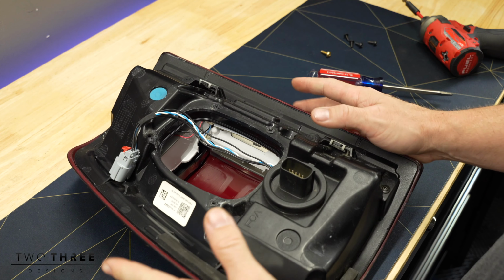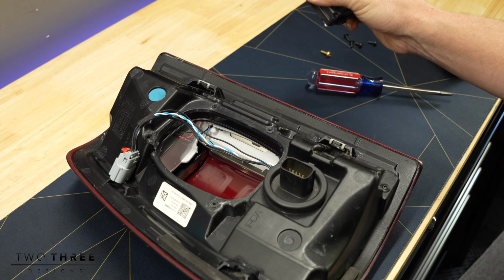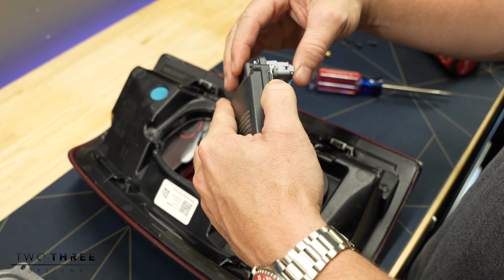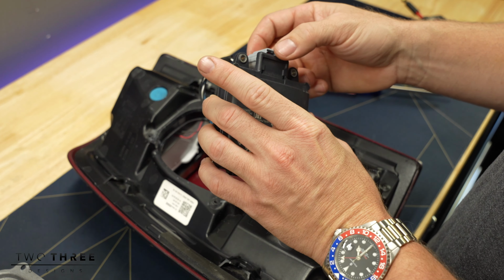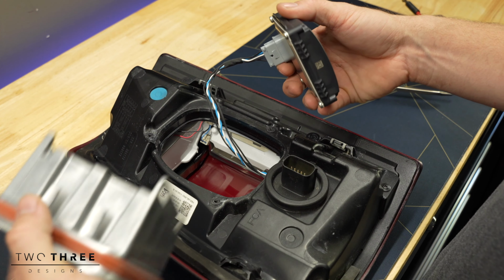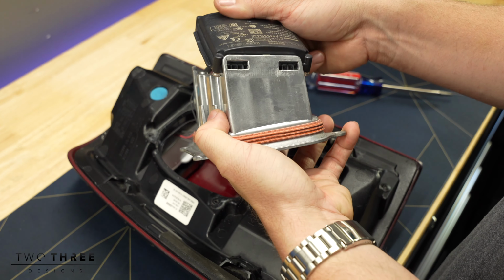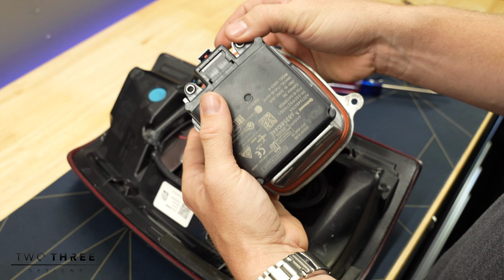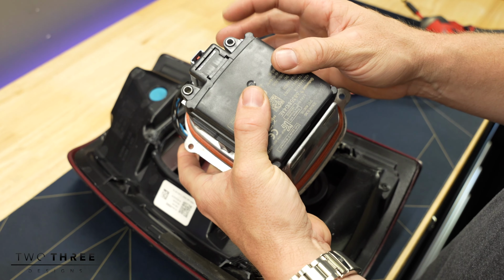So now you can take your new taillight with the sensor and heat sink from your truck. Go ahead and install the pigtail onto the sensor first. Make sure you hear it click and lock down the tab. Next, slide it into the bottom where you see the 2 slots and push in so that it meets the top where you'll add your 2 gold screws.